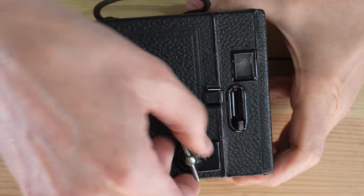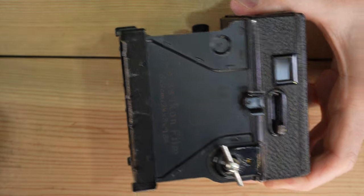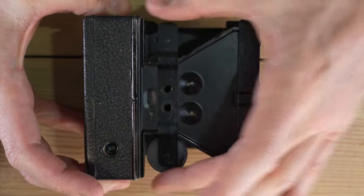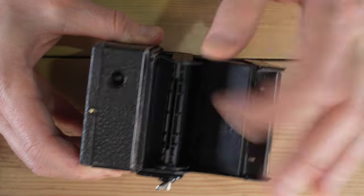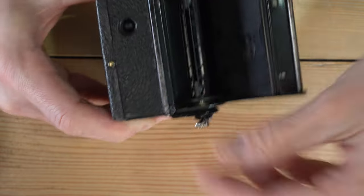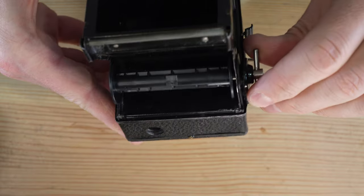Now let's look at how to open the camera. You lift up the clip and the back slides off. Inside, there's information about the film type — Zeiss Icon film, 6x9 centimeters. On the other side there are mechanisms to hold the film in place. This is the film take-up spool. When you load new film, you need an existing 120 spool here. You angle the spool into the spring, drop it into the take-up position, and turn the take-up knob and spool until they seat.